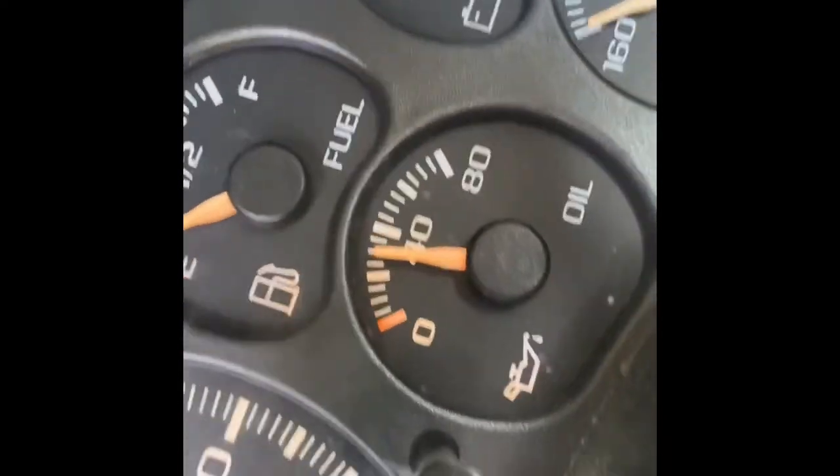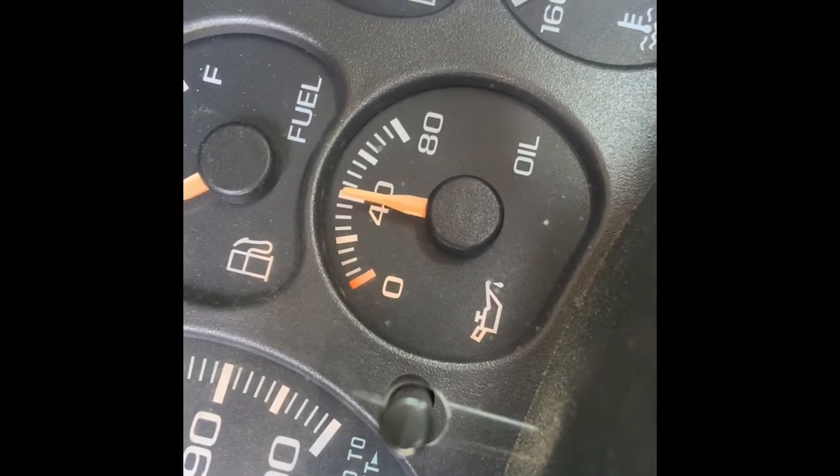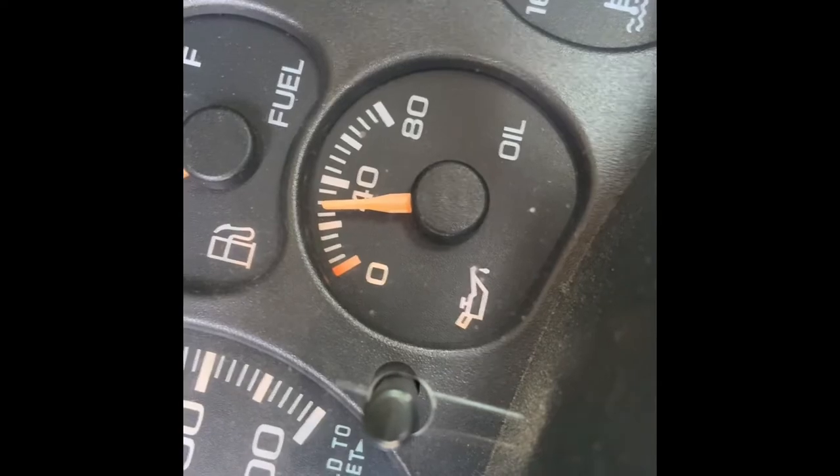this is what I'm talking about with my oil pressure. It is right there at a cold start. Which, even as bad as that is, sitting right at just below 30 at idle, it moves up to just above 40 when you give it gas, which it would not do before. And it used to cold start at like 18 or 20.